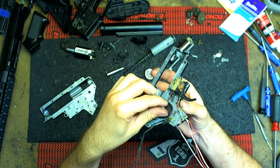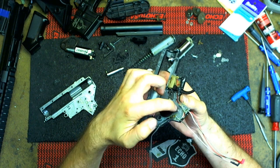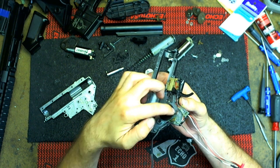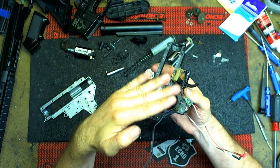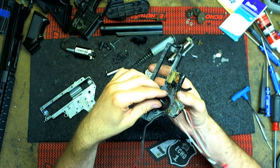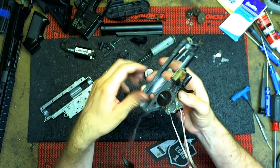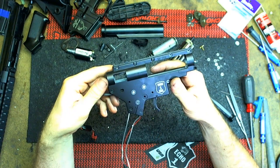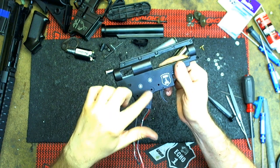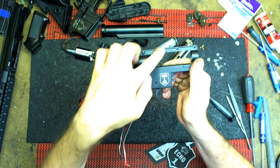You basically want to look and make sure that the spur gear doesn't rub on the bearing or the bushing, depending on what you're doing. If it's too low or if the lip is too much, it will rub. Right now I probably have too many shims on there, but I'm just showing you what to check for. Here it is with the 8mm bearings, gears, and some shims, with the screws installed.